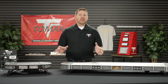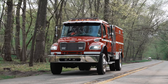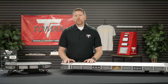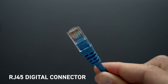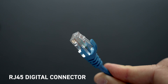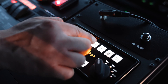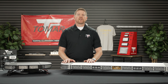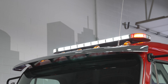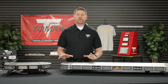With the built-in internal controller, the 970 can be operated from either 12-volt trigger wires over virtually any control source, or ordered as a plug-and-play unit through the optional RJ45 digital connector. When optioned with the RJ45 and mated to a Tomar 940 or 948, programming the light bar's flash patterns and flash rates can be accomplished through the digital control panel. Standard bars without the RJ45 digital connection feature a programming wire with a traditional tap-to-program feature.